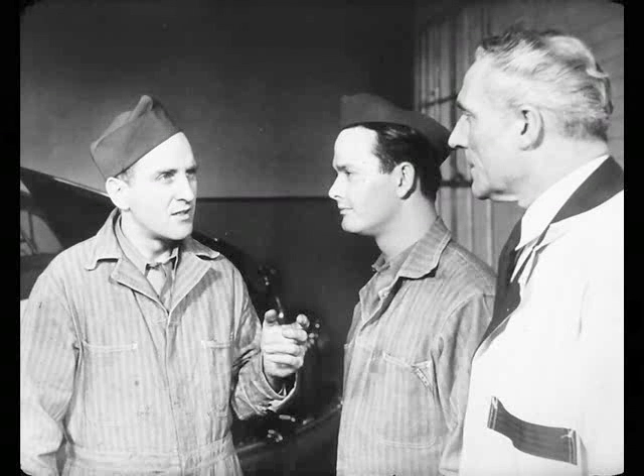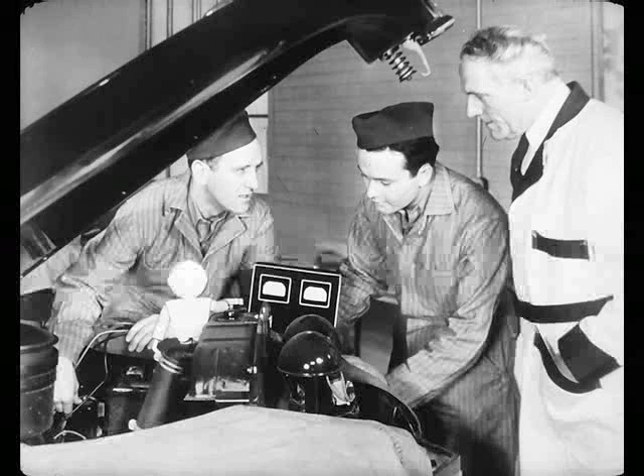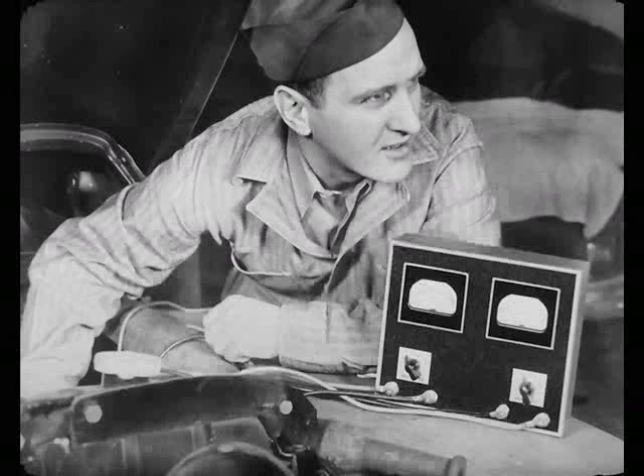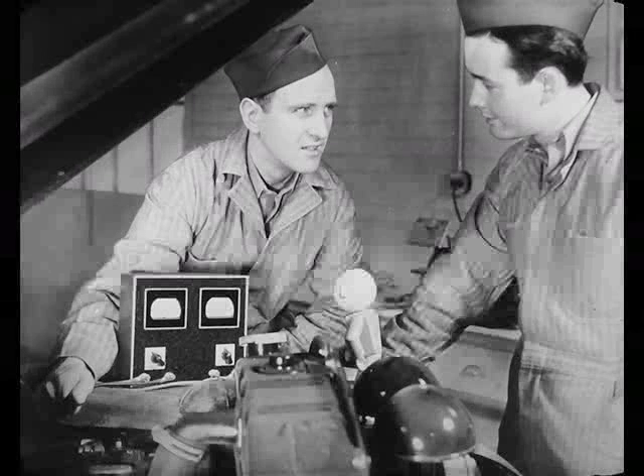So I knew I'd have to take the cover off and adjust it. So I took off the battery cable. You're one of those guys who always remove that cable before taking off the regulator cover. Yeah. I like to be sure that I won't short out the regulator. And besides, the cable's easy to remove on this model. Now, from my ammeter reading, I know that the spring tension on my current regulator's armature must be too light. So I bent the lower spring hanger down to increase the tension. That keeps the contact points together until enough current flows through the windings. I watched the meter while I bent the spring hanger and got the output to come up to its rated capacity.